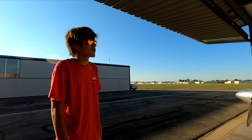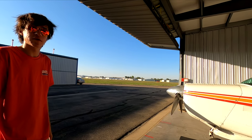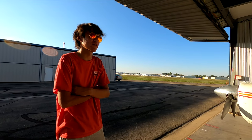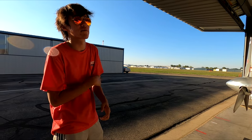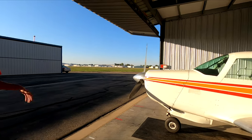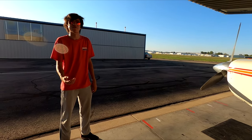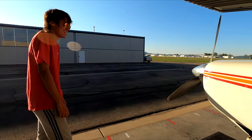Wow. Now, obviously it's retract, and this is 200 horsepower? Yep, so it's not high performance. And do you have constant speed or fixed? It's constant speed. All the Mooneys were constant speed. I think there was one model that came out like a trainer. Was it the single passenger Mooney? All the M20s were constant speed, except there was an M20D that had a fixed gear, and then you could remove a pin and it became retract. The idea was you learned in the Mooney and then it became a retract after you finished learning in it. It didn't really take off. It didn't take off, no pun intended, right?